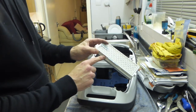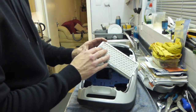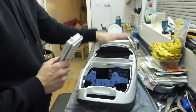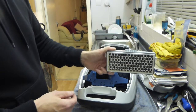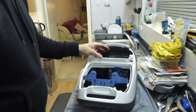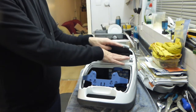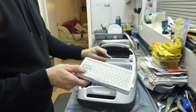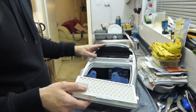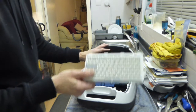Because these are about £20 to buy. Or you can buy another type of filter grill from Miele that you can use with the standard filters that come with packets of bags — when you buy boxes of High Clean bags, or Air Clean as they are in the US, they will come with an exhaust filter which you put in here. But if your machine was originally supplied with one of these HEPA filters, the Air Clean 50, then you can't fit the filter that comes with the bags — you need to buy a filter grill that fits in here. That filter grill has got a lid; you open the lid and put your filter inside. The last time I saw those grills they were about £10. They're not dear, and it means you won't have to buy these again — because these are £20 a throw at least, in the United Kingdom.